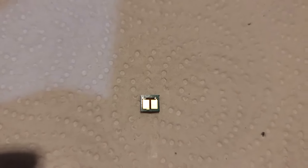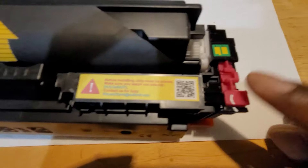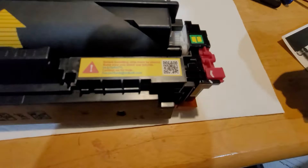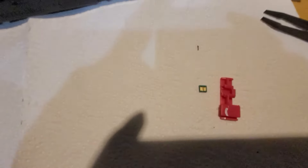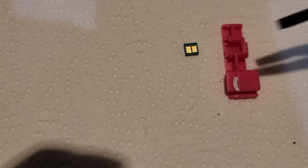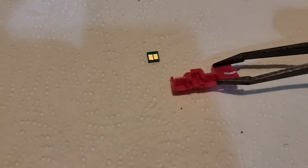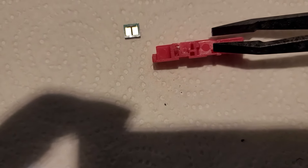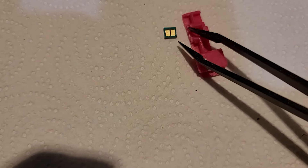This is the chip that's going inside the aftermarket cartridge. First, pull out the placeholder chip from the new cartridge. Once you pull that out, the chip goes this way — pay attention to the orientation. You're going to slide it into the compartment right here.